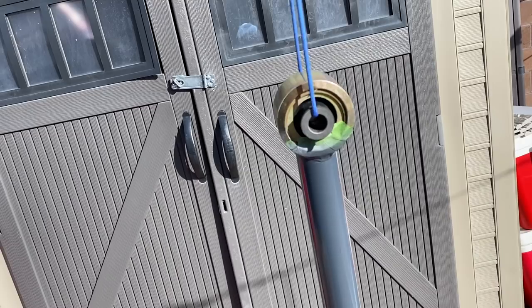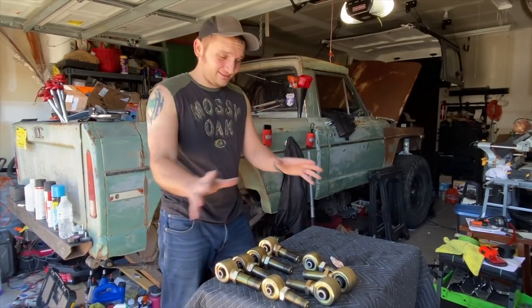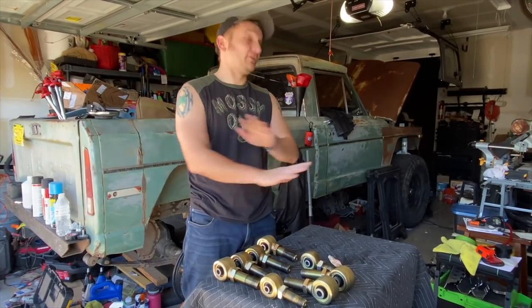Before I put these in I had to paint them - I decided on a color. I went with a gunmetal gray. I think it looks nice. I didn't paint them specifically to prevent rust, I just don't like a lot of color underneath my Jeep - I like things to be a very matte color, kind of drab, I like it to look very European. All I did was hang them up, take the joints off, tape around the joint to prevent paint from getting in there, hit it with primer, let that dry, hit it with two coats of paint, then did a clear coat.